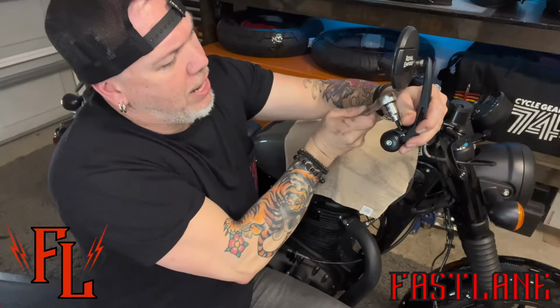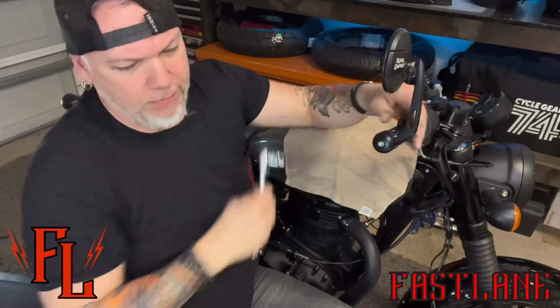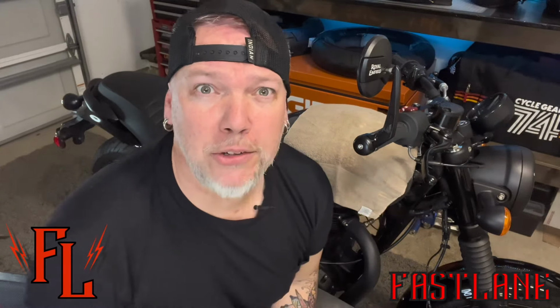Just gonna cinch down. You're gonna feel it start to tighten up. Don't overdo it. Make sure your throttle still snaps back. Feel that? That's not moving at all. That's great. Do the same thing on the other side and you're done. Let's go take it for a ride and check them out.